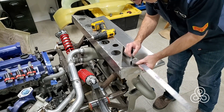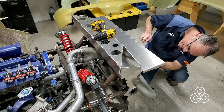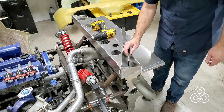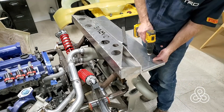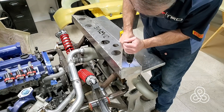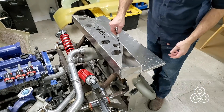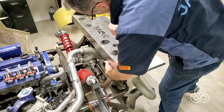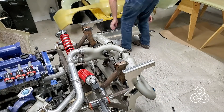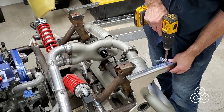Now those quarter-inch plates that are mounted to the subframe come up and have a little flange on them. We're going to put some blind rivet nuts in there so this thing can be bolted together. I'm marking those off now to line up with that brace underneath. Get our bolt hole drilled through, take the thing apart, and then that'll give us access to our quarter-inch plate braces. Then we'll go back with our larger drill — the size we need for our blind rivet nuts.